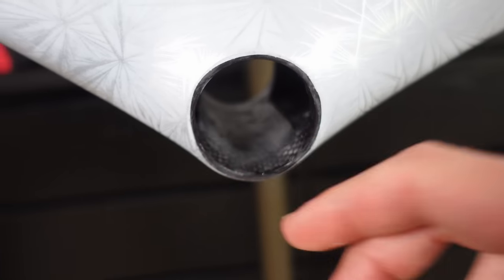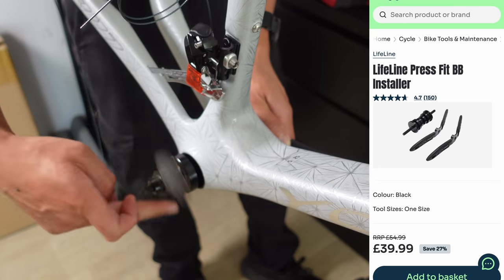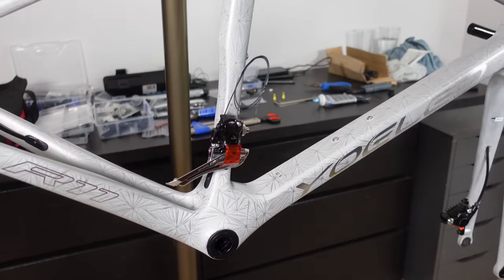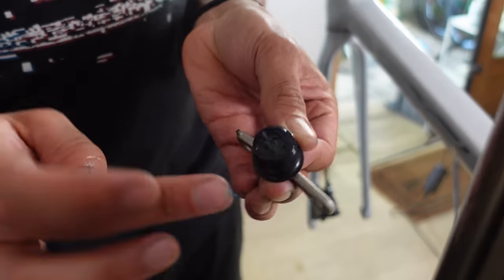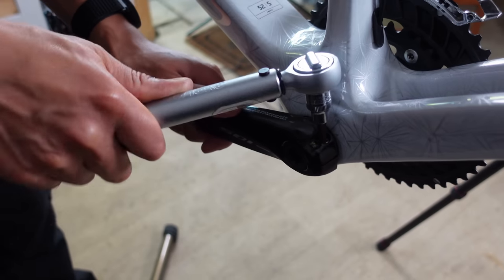Let's shift focus to the heart of the bike's rotation — the bottom bracket. It's a BB86 bottom bracket in this frame, and that's a press fit. It's best to tackle press fit bottom brackets one side at a time; it's like putting on a pair of shoes — you wouldn't try and slip them both on simultaneously. Start by greasing the bottom bracket bearing seat. With the bearing press in hand screw one side in, then repeat the process for the other side. The aim is to ensure everything is straight and aligned — a quick visual check should reveal no gap between the bottom bracket lip and the frame. With the bottom bracket in place it's time to introduce the crankset. Begin by greasing the crankset and importantly the spindle. Slide the crankset into the frame — sometimes it might need a little persuasion. Next grease the thread lock nut; this component screws into the end of the spindle and you'll need a specific install tool. With that in place torque up the crank arm bolt to 13 newton meters, tightening both gradually to ensure an even fit.